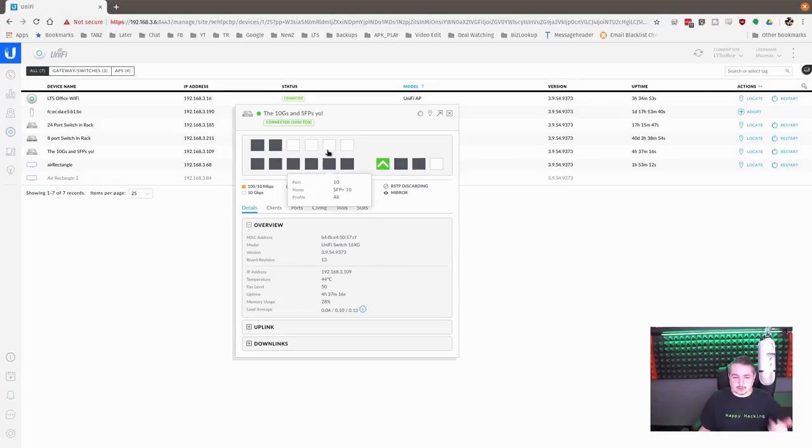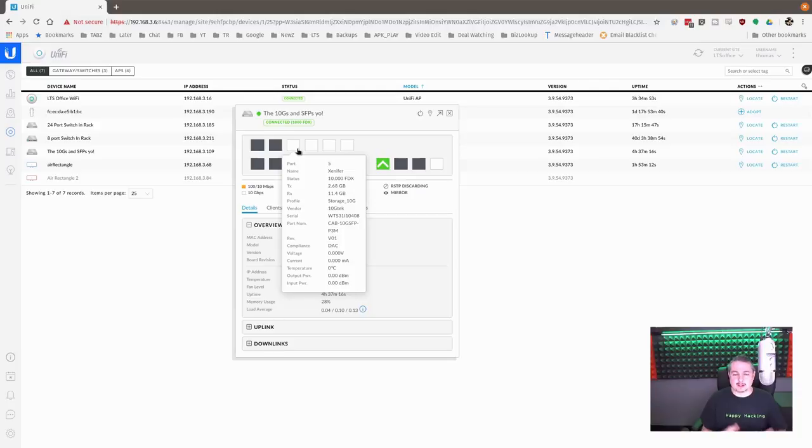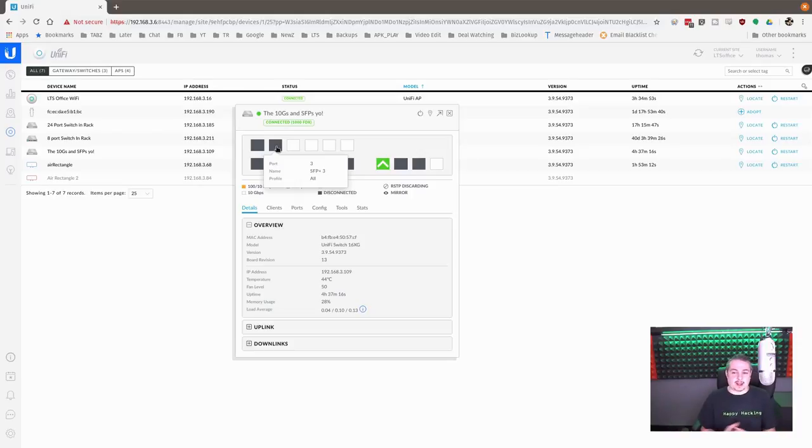And then the other advantage you have here, because this is all, as they refer to, software defined, I can easily go here to any of these ports and add one of the other VLANs and gain 10 gigabit connectivity to that specific device. So once again, some of the software defined networking features that work really well with UniFi is I can on the fly just assign this and it will add that to that port. And then without physically changing network, we can have 10 gig access.